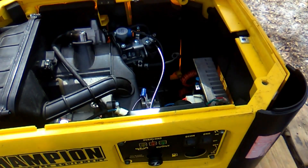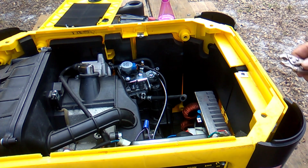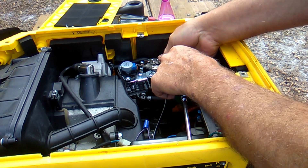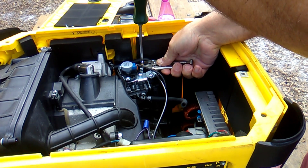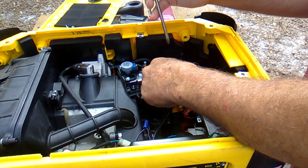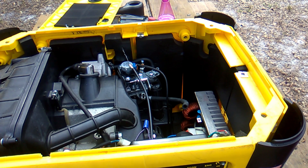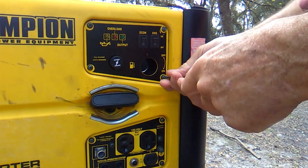Move the clamp, pull it off, grab it over here — that'll take the choke off. Get the Phillips screwdriver, and with a nice set of grips there, hold that while I unscrew it. Take this big Phillips screw loose and pull it right out of there. After that, get the choke loose — there are four Phillips screws right here.